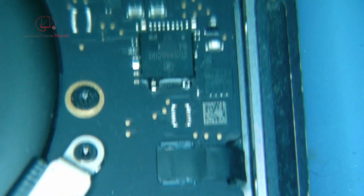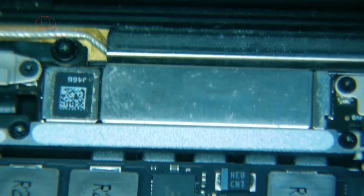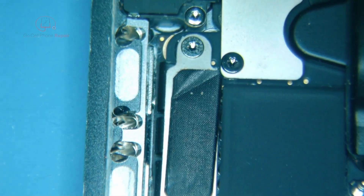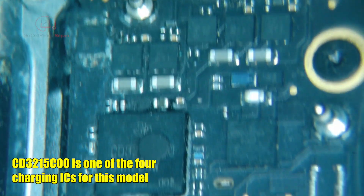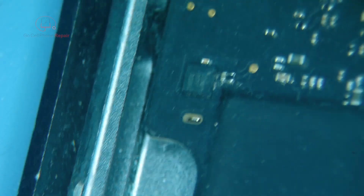Looking into the microscope — on the right-hand side, which would be the left if I flip this open — everything looks pretty clean. I thought this looked a little foggy, but nothing major. Over on the left-hand side it's a different story. We've got signs of corrosion here inside the charge port. You can see that CD32 has corrosion on the outside of it, so we're probably going to have a charging system issue. Down here there's corrosion as well, so it looks like it came in on this side.